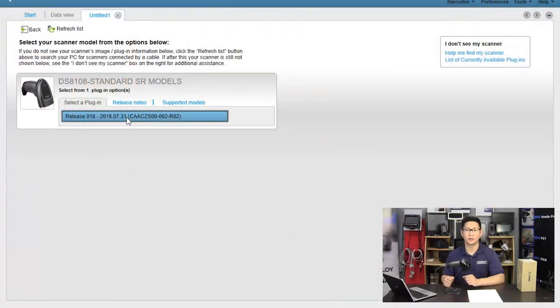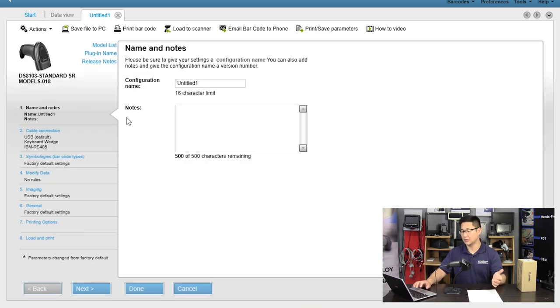The second way to add precision to a barcode scanner is to add barcode priority. In order to do barcode priority, you're gonna have to download 123Scan. I'll put a link below to our website where you can download 123Scan. You'll need to plug in your scanner, connect it into the program, and then select your scanner. There's a 123Scan tutorial video that I'll put a link to as well for kind of the basics of how to use 123Scan.